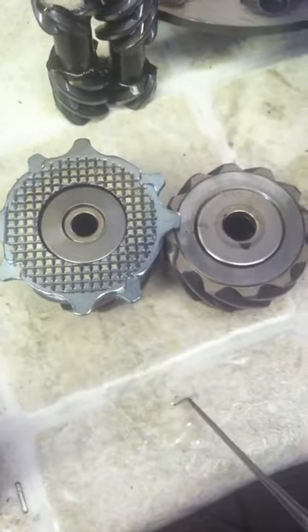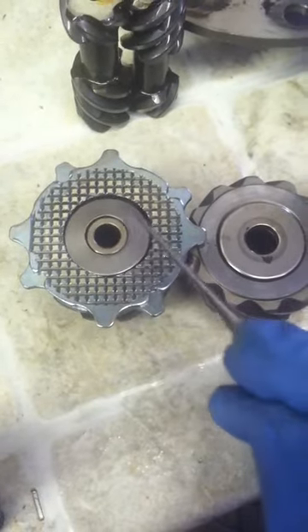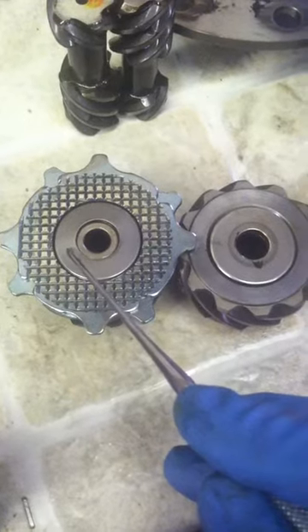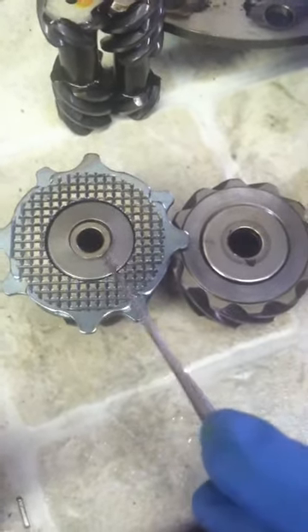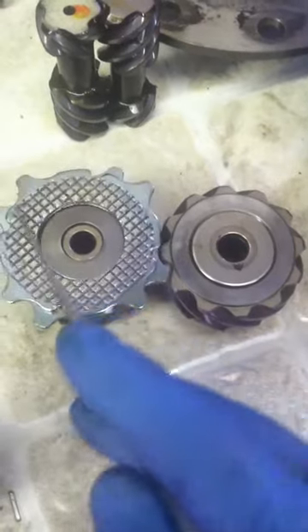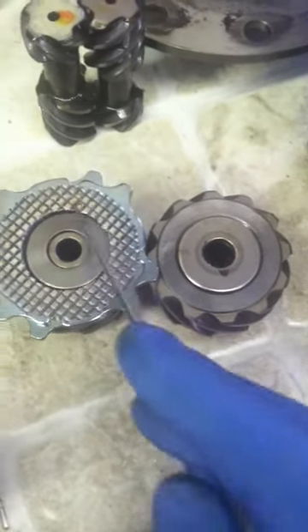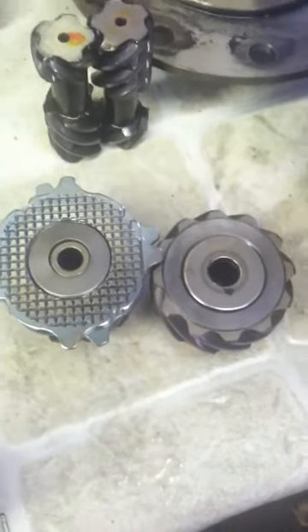As we've discussed online, these are more sensitive to fluid than anybody sort of previously advertised. The Torsen differential does require a specific fluid — that's what we're finding out for the Spec Miatas. Don't run Redline Shockproof. It tends to congeal into a grease on this clutch and fill these gaps. This whole thing ends up looking greased, and I really think it's affecting the Torsen effectiveness.